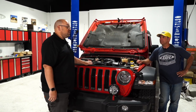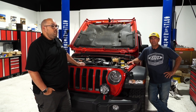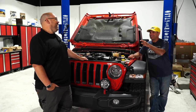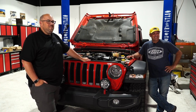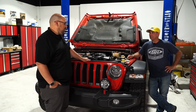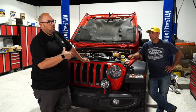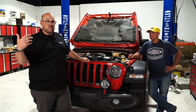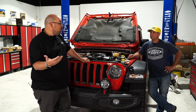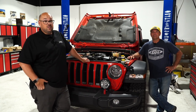A viewer asks if they make one for the 3.8 — just the 3.6. Tony notes he has a 3.8 and is disappointed. Terry Runyon asks about max boost on a JK 3.6. Edelbrock doesn't state boost numbers because elevation affects it — boost in Southern California will be different from Colorado. On average you'll see five or six pounds. It's not a huge amount of boost, but it moves air effectively and is emissions legal.